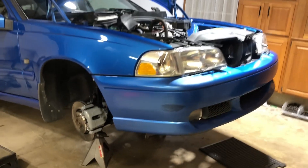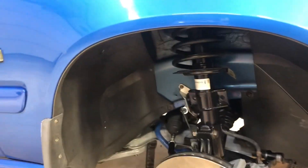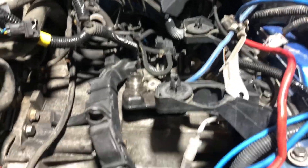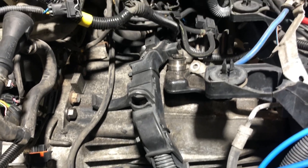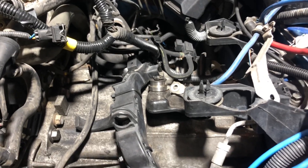Slowly but surely, got the front suspension all completed, back in. Obviously the subframe's in — C70 subframe and brace. The M56 is in with the C70 wiring harness complete. I've got a manual wiring harness with the correct mounts. Just got to get this finalized here, but the trans is in, and so is the limited slip.